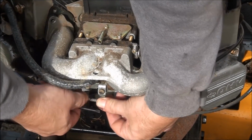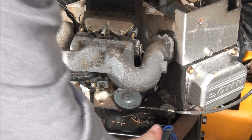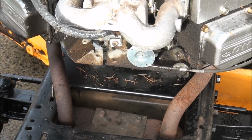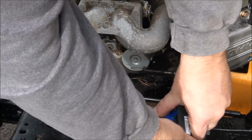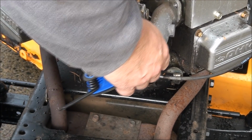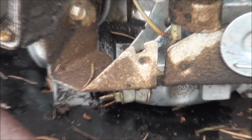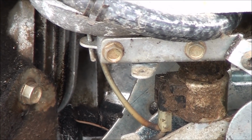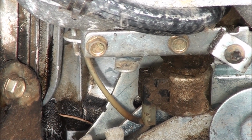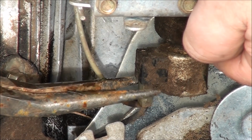Alright, and just pull it down and pull it out. And then your throttle cable down here. You see what I'm working on down there? Yeah. Alright. So there's still a couple of linkages where we're connected. One area where we're still connected is the fuel solenoid there that I was talking about earlier, or the anti-backfire solenoid. That's the little component that should click when you turn your key to the first position. And it's just an electrical plug-in.